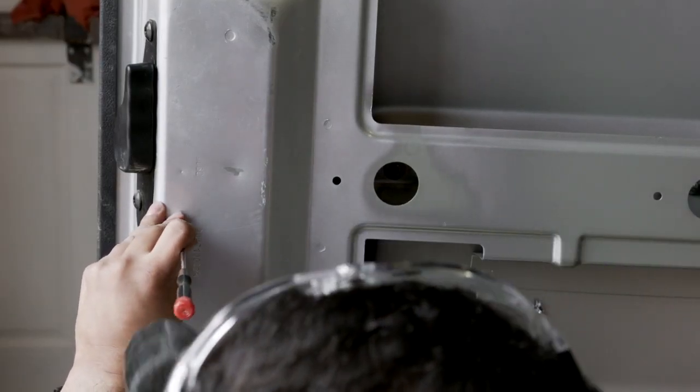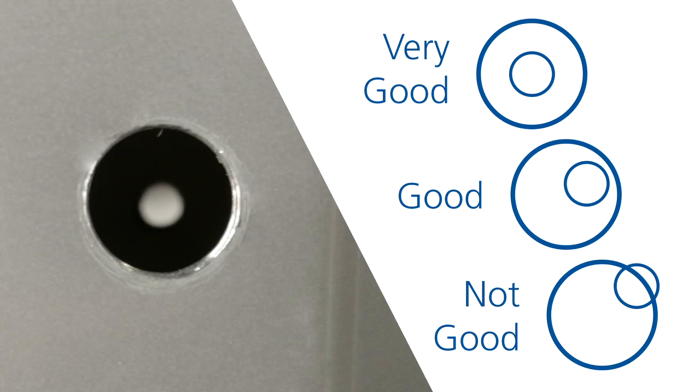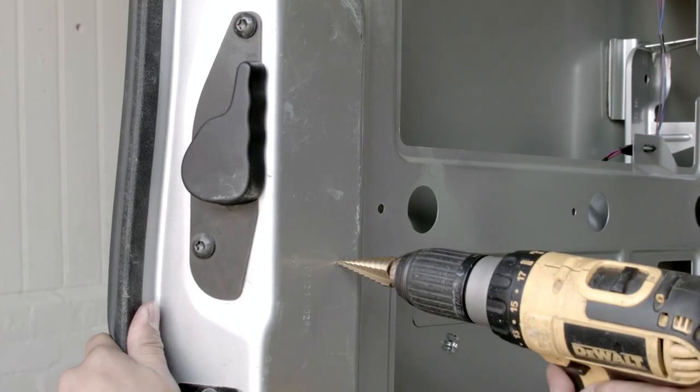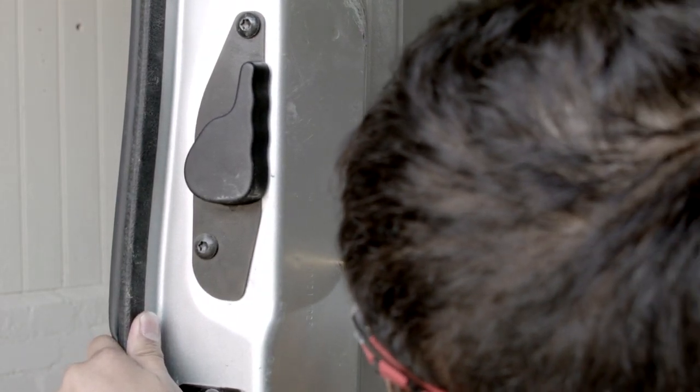If it's not possible to mark the inner skin, we will need to make calculations where these four holes should be. These holes are for access only, so they do not have to be perfectly in line with the holes in the door skin. However, they must surround the door skin holes completely. Once these four positions are identified, we can drill the holes using the step cutter. Each hole should be between 20 and 21 millimetres in diameter.